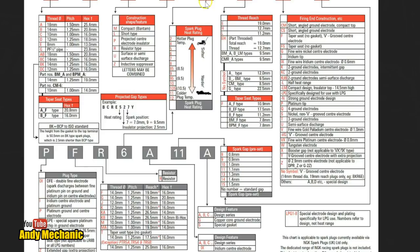Next is a number — it's a number six — and that's to do with the heat range. Most people know the heat range. One thing to bear in mind is the lower the number, the hotter the plug temperature, and the higher the number, the cooler it is. Very important not to get that mixed up, as Benjamin found out with his DT. Holed the piston, poor lad.